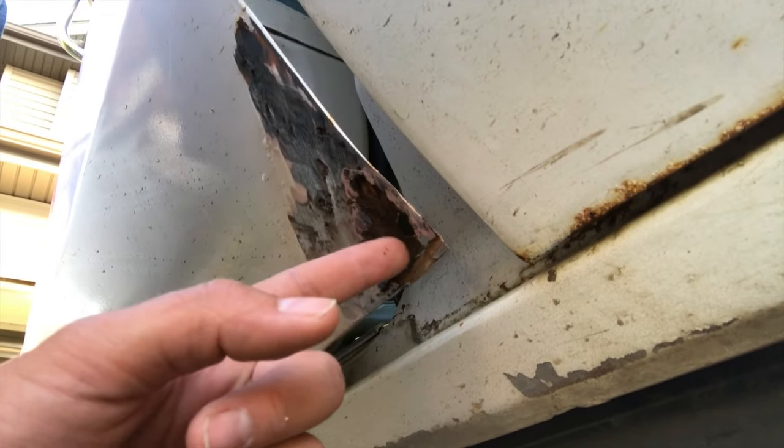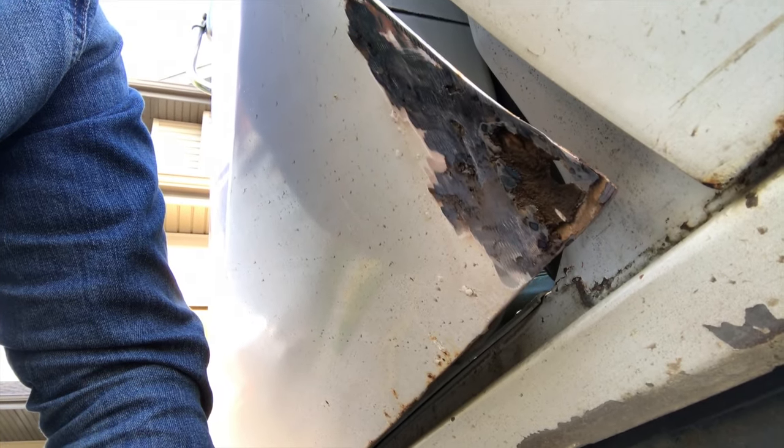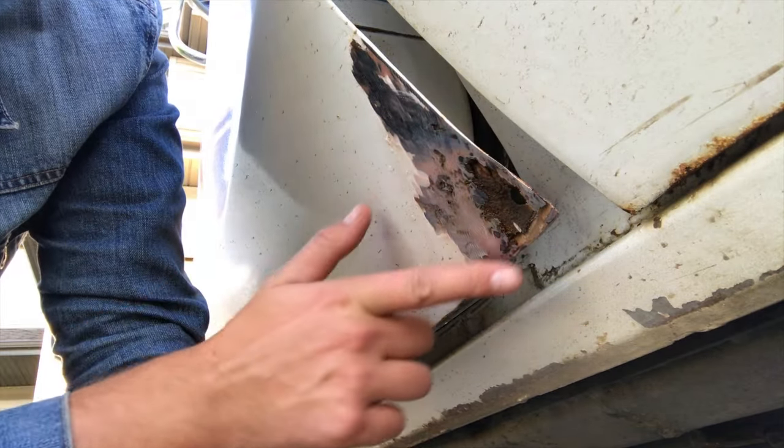The chunk of old filler came out — that's fine. What happens is water gets inside and it actually starts to rust from the inside out. So I'm going to have to treat the back side of this door after we get it filled to prevent it from rusting out as quickly. This isn't going to be a perfect fix for a long time, but it will last us probably a few years before it starts popping back. So I'm going to get the filler ready and start to fill this.